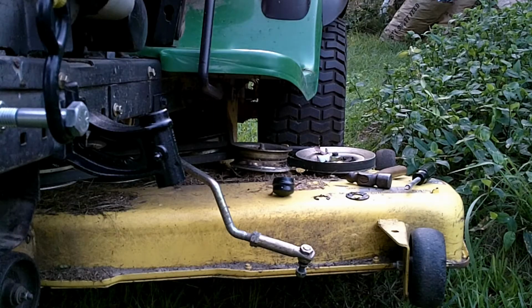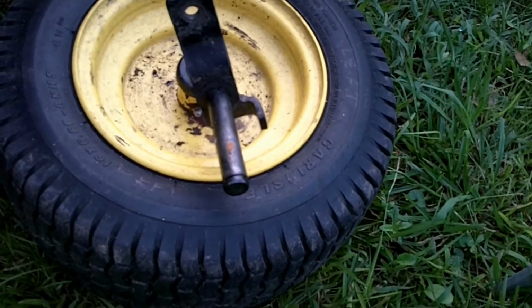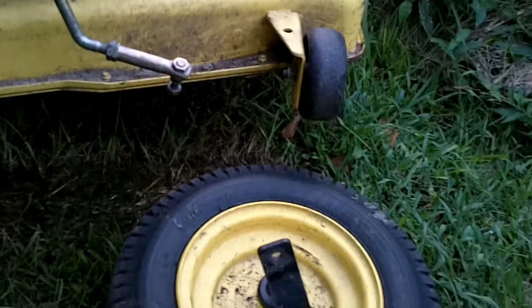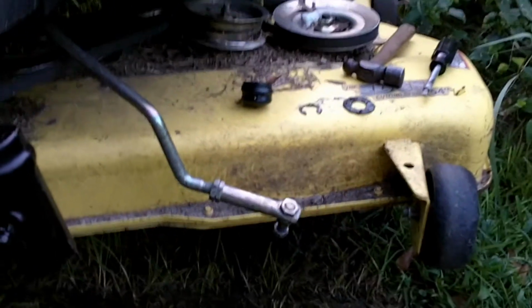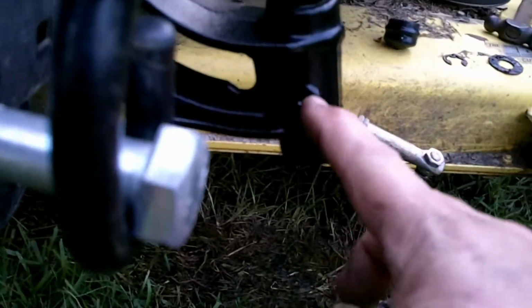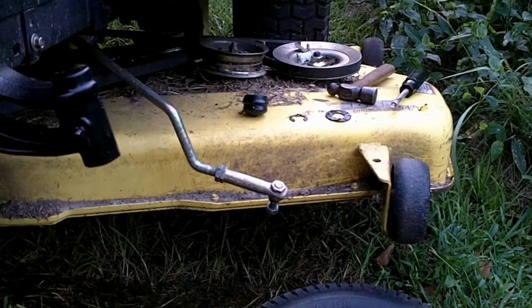Alright, let's put the wheel back on here. So we have the axle, we have the spindle itself, which you can do with or without the wheel on it, and you slide that up through the bottom of the axle, like so, and then on top you have a washer and a little C-clip and a little cover that just keeps the grease from squirting out when you fill that little thing up with grease right here. That little cap is actually the hardest part to get on.